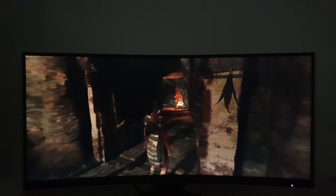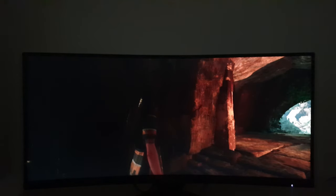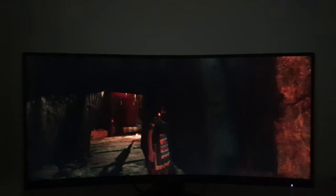There is also VA glow, which is associated with VA panels — some have more than others. Ultra-wides like this tend to have a moderate amount, which is fairly average. You can see it towards the bottom corner, and it tends to be more visible towards the bottom corners from a normal viewing position. That's why I've positioned the camera in line with the top third of the screen, which is the ergonomically correct eye position. You don't see it so much towards the top or centrally, but it does affect the atmosphere — though it doesn't have the same atmosphere-breaking effect that IPS glow does.